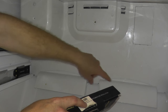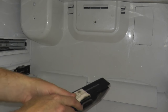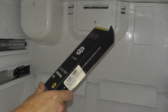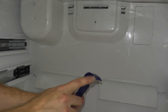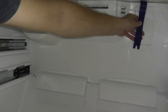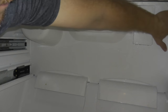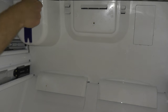Now I need to remove this back cover. On the bottom there's some ice I want to clean up, because typically there's a drain tube or a drain hole somewhere, and you want to remove any iced-up conditions that may currently be there. This is a trim removal kit — really made for vehicles to remove interior trim pieces, but you need a tool with something like a 90-degree angle. You get the tool behind there and pull, and then if you can put your hands in there, get on the other side — that's it.